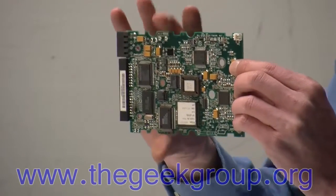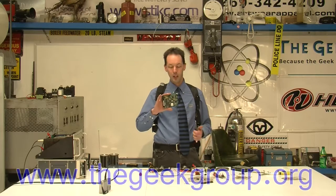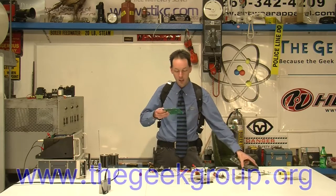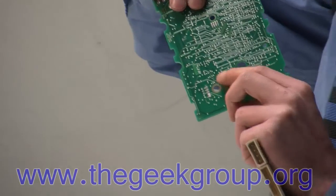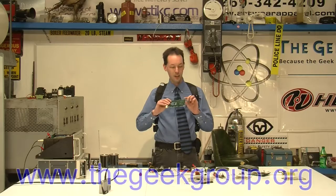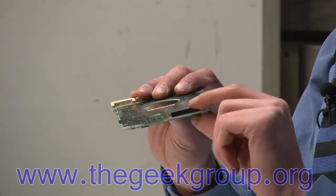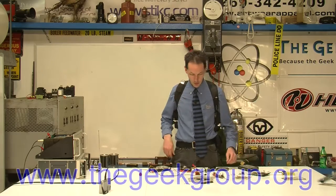This is the logic board of the drive, so you want to take the board off. Now, this varies manufacturer to manufacturer. On the bottom of the board, some of them just have a cable that goes off and disappears inside the box of the drive. Some have little contact feet that are totally flat — just little shiny feet. Some have a little header, a black thing that actually sticks up from the drive about a quarter inch and is about an inch to an inch and a quarter long. That's the best — if you find one of these, you really lucked out because it makes it easy to do. You don't need the logic board part, throw that away.